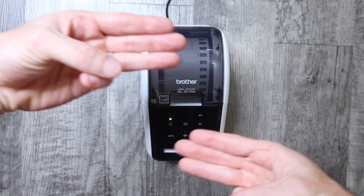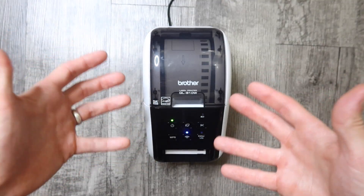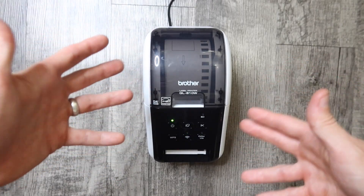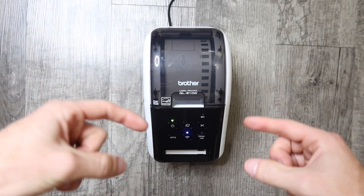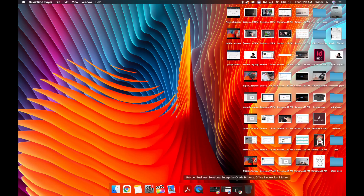You're going to have to find the WPS button on your Wi-Fi router — it might be on the front, side, or back. If you have a Wi-Fi mesh router it might say 'sync' and you hold that instead. Mine has a WPS button on the side — I'm going to press and hold it, the front light starts blinking, and now both my Wi-Fi and printer are in WPS mode. You have about a 30-second to one-minute window, and it will take about 30 seconds of blinking before you get a solid blue light, meaning you are connected to Wi-Fi.